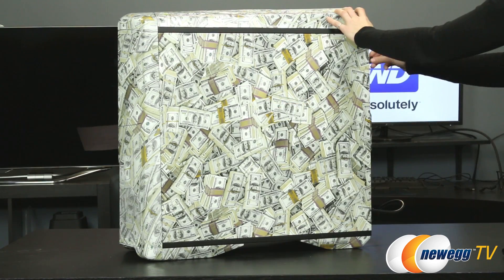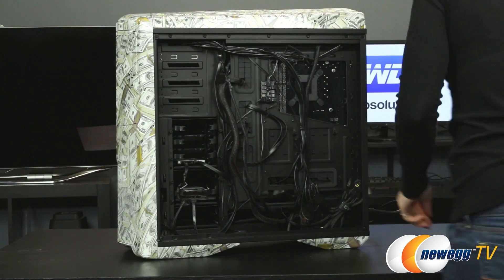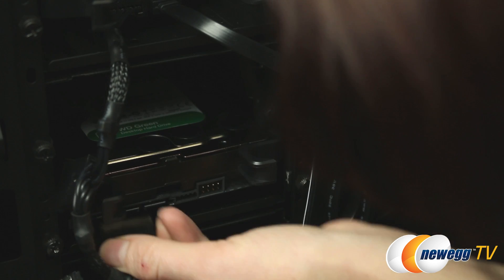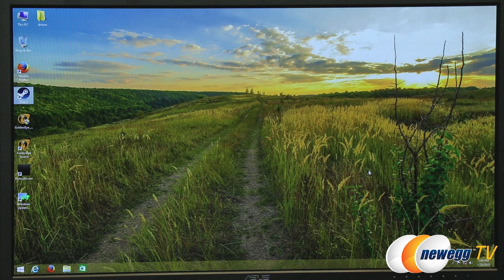Next, I'm going to show you how to add storage to an established system. For fastest boot speeds, use the Green Drive in addition to an SSD boot drive, like the 256 gigabyte drive in this system. We have already installed the operating system — if you want to know how, check out Paul's How to Build a PC video by clicking the link in the description below. When installing the Green Drive, be sure that you have the appropriate connectors available from your power supply and a new SATA cable. Don't forget to clean up your cable management after you're done for best airflow and to alleviate tension on connectors that may get squished by a side panel.